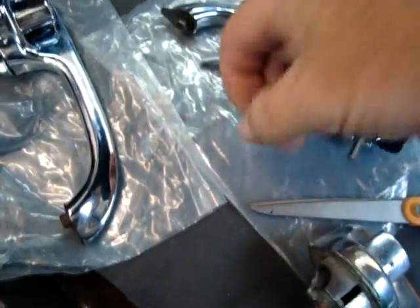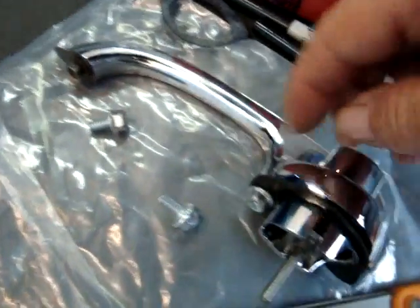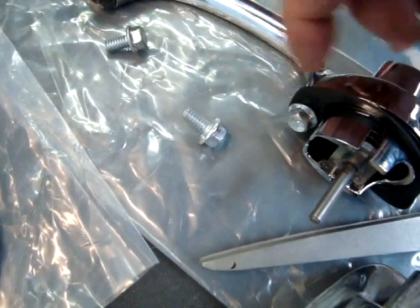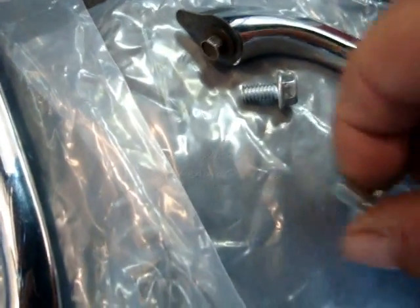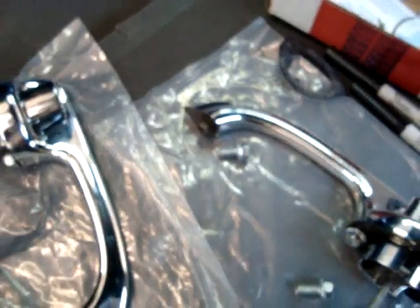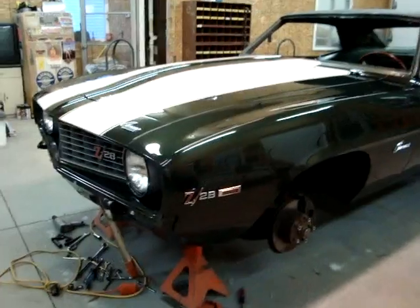Little things you have to do on this job. Also, these are the fasteners that were supplied to hold the handle on. I'm able to use the larger fasteners that come with this handle right here on the main body, but here on the short thin end of the handle I had to use one of the factory studs — it's not as long. The supplied ones won't go in far enough, so short of grinding them off, I just put the factory bolts back in here. Just things you run into using the aftermarket. We'll bring you back for the reinstall.